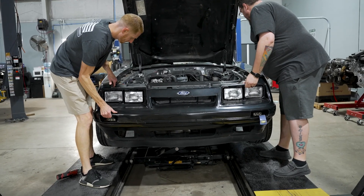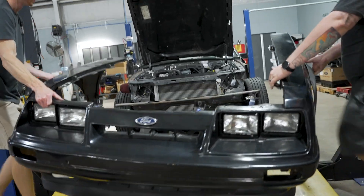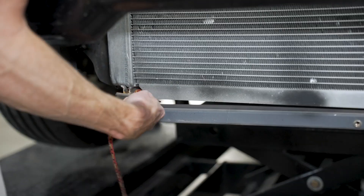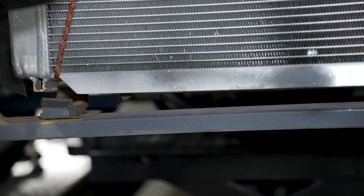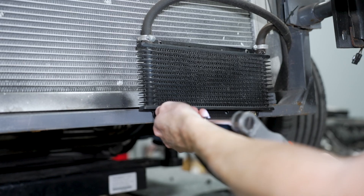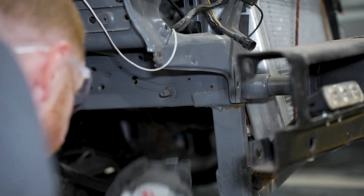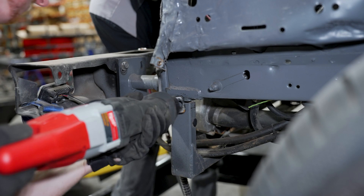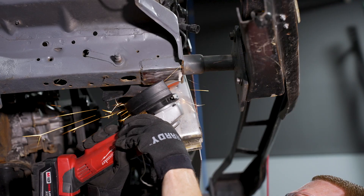To get started, make sure you're working in an area suitable for grinding and welding. Support the entire car or just the front, go ahead and remove the front bumper — we have a dedicated video on front bumper removal linked in the description below. Now remove the upper radiator hold-down components, which could be different from car to car. Lift up on the radiator and support it on both sides with some bungee cords or something similar, just be sure you don't damage the fins. With the radiator supported, check over the area and remove anything else attached to the lower section of the core support or the surrounding area that could get in the way. Once everything is removed, you can start cutting the core support even with the underside of the frame rail. Michael's car has an existing lower support already installed, so our situation is different than a factory setup. Before cutting the other side, have a friend hold the lower section so it doesn't come crashing down.